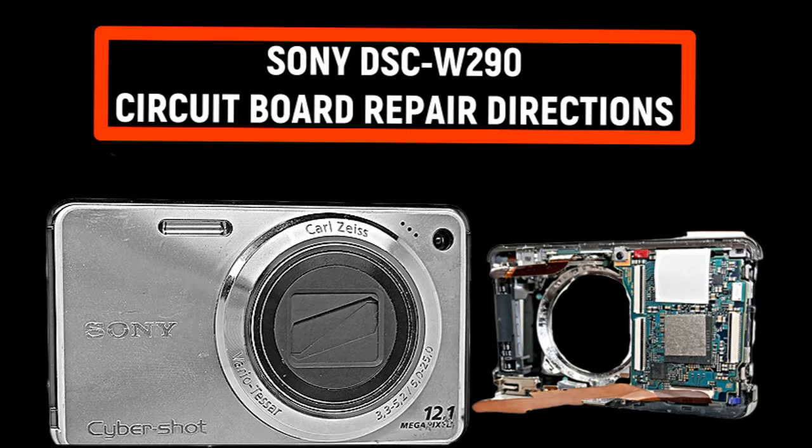You should only need 3 tools to complete this repair. You'll need a 000 Phillips screwdriver, a standard kitchen butter knife, and a pair of tweezers or needle nose pliers with smooth jaws.